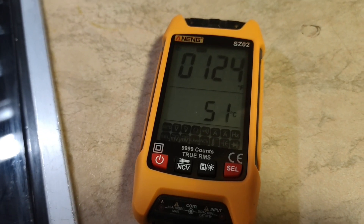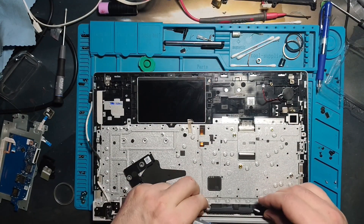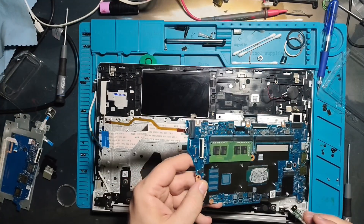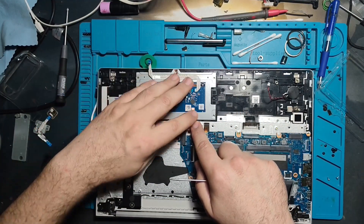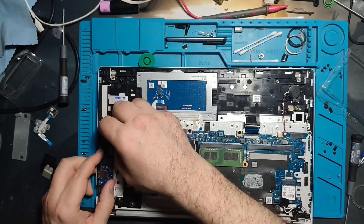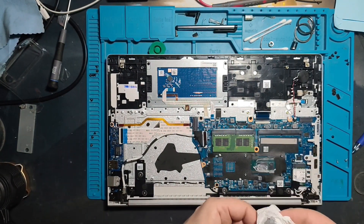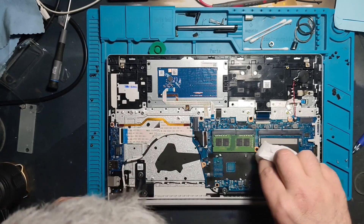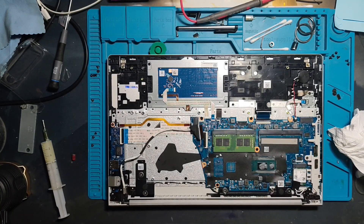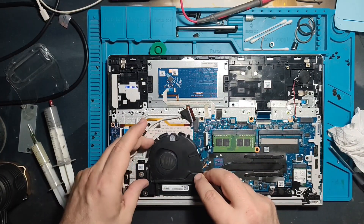Once the cooking is finished, I use the oven again at around 50 degrees for half an hour, but before that I use an air blower to blow out as much water as I can from the keyboard so it's almost fully dried. The oven will then complete the drying 100%. After everything is completely dried, it's time to reassemble the laptop and test whether this method actually did a good job cleaning the keyboard.